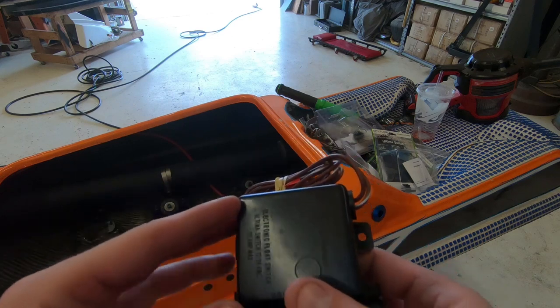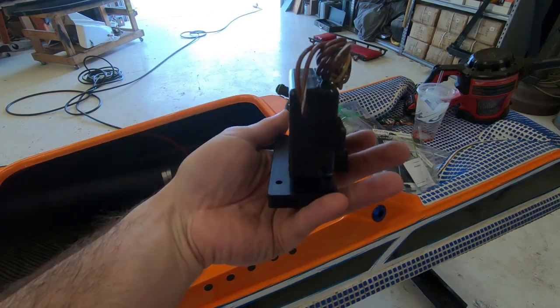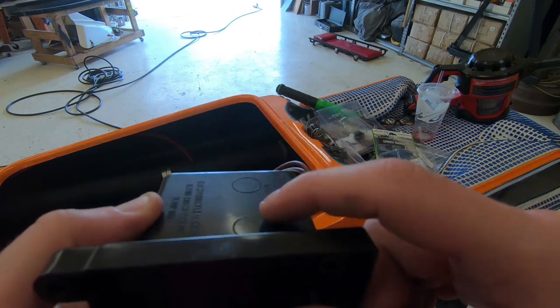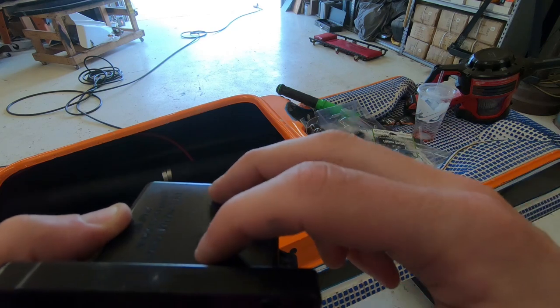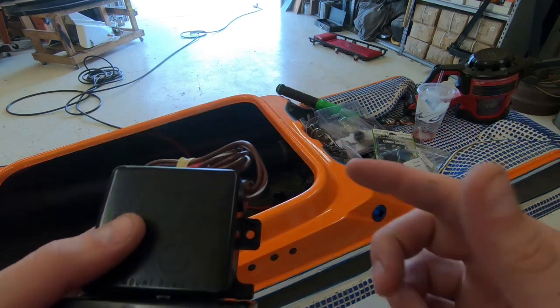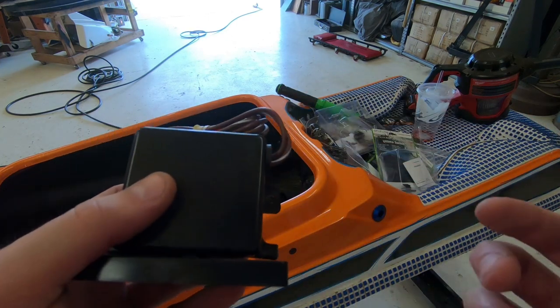So you're going to have this in your ski. Preferably it needs to be upright like this. And you see these little circles. There they are. There's a circle, there's a circle. When water touches these two spots, it completes a circuit, and it turns on your bilge pump. Whenever water's not touching them, it'll stay on for a few seconds, and then goes off.